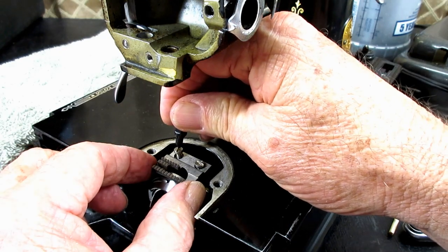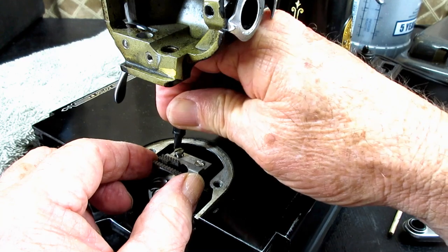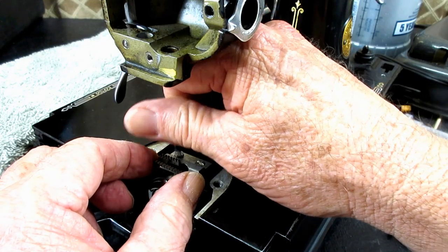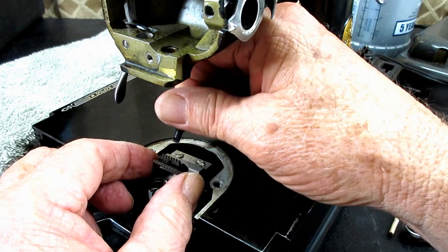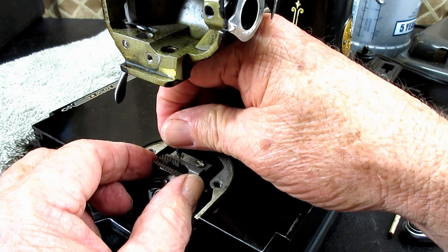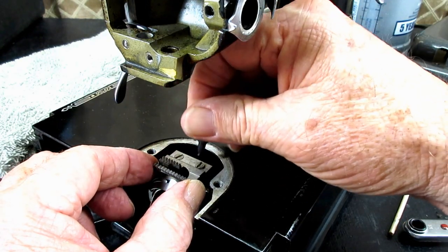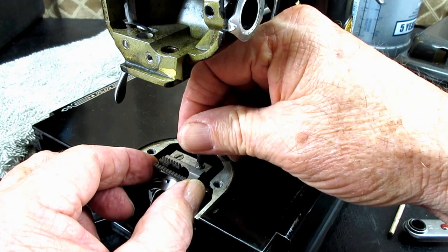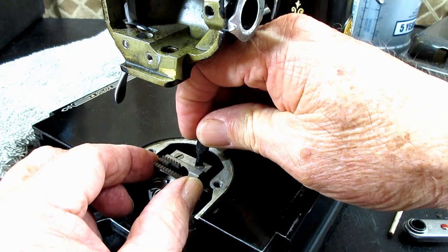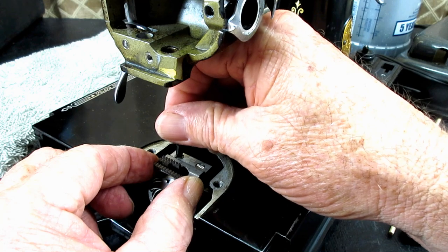I told you I have trouble with this machine getting screws started. I don't know why. It's very finely machined. Maybe I'm losing my touch. So what I like to do when I put it on is I'll just tighten it until it first stops. I won't twist it beyond that point. So that's what I just call, you know, finger tight, if that. See, it's still moving here. Then I'll come back to the other side and I'll get that. And then you're still moving around a little bit, so I wiggle it. I just kind of wiggle it as I keep tightening it a little bit at a time, until there's no play left in the screws.